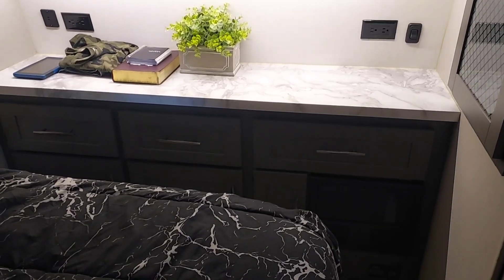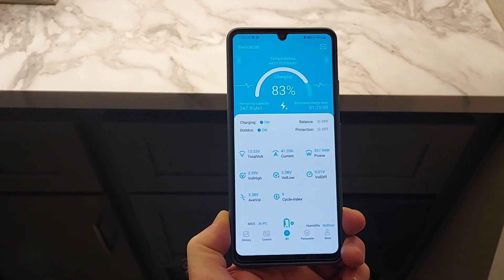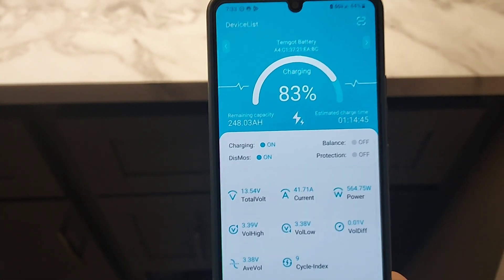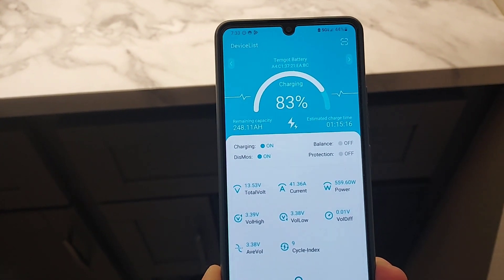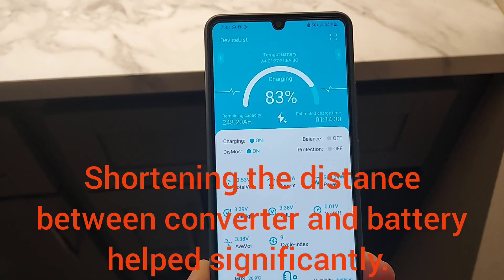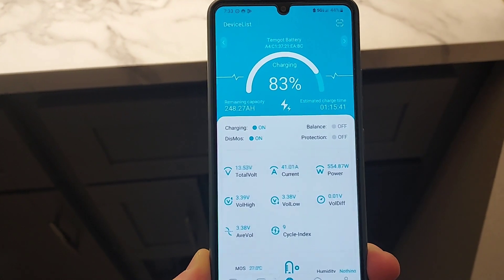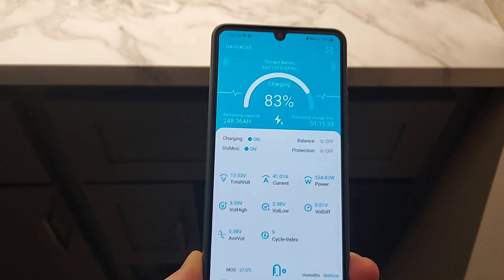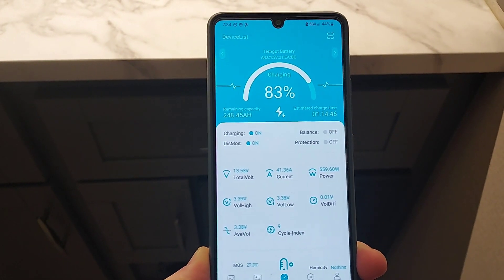I think we're going to end this video update here on the converter. I can't get it to go back to lithium — initially when I hooked this up you saw in the first video it went to lithium, but I'm not able to do that now. You can see it's really cranking out the amps and I'm at 83 percent. Yesterday when I took it down to 37 percent it was cranking out the full 55 amps the converter can put out. By changing my wiring that did help charge the battery faster — before I changed that wire it was only at 30 amps, so this significantly increased the charging. I'm going to contact Wifco and see if I can get the jumper to keep it in lithium mode permanently.